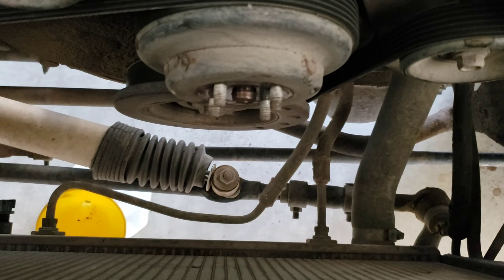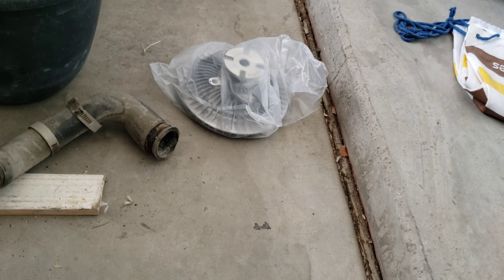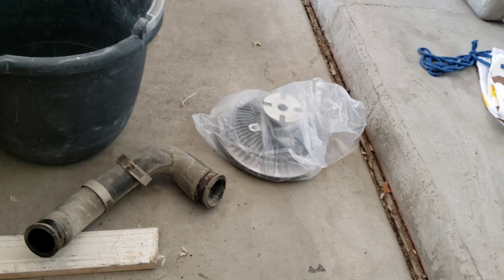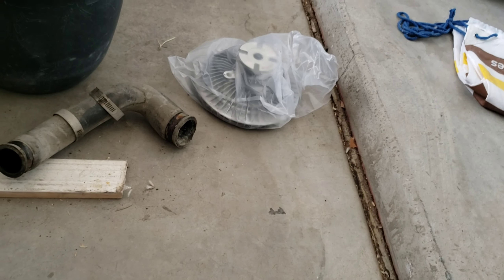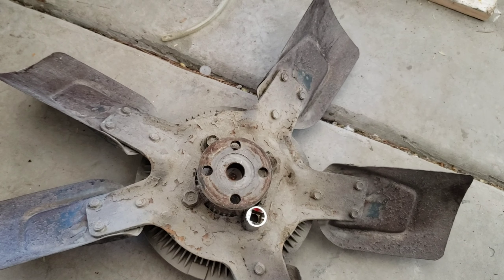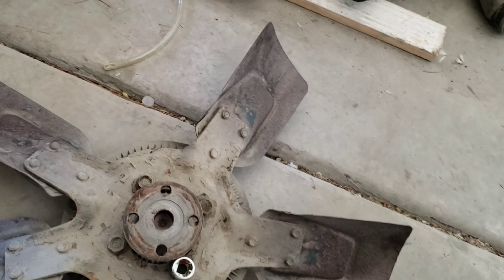With that, the fan clutch just pops right off. The whole fan comes out along with the fan shroud. If you're having overheating issues, that could be one reason you need to replace the fan clutch — typically when you're sitting or idling is when you would notice issues. It's so cheap you might as well replace it if you're replacing everything else. If you're just going to keep this fan — and there's almost never a reason to replace the fan itself unless it's all dinged up — you'll just remove these four half-inch bolts, then bolt it back on and put everything back how it was.